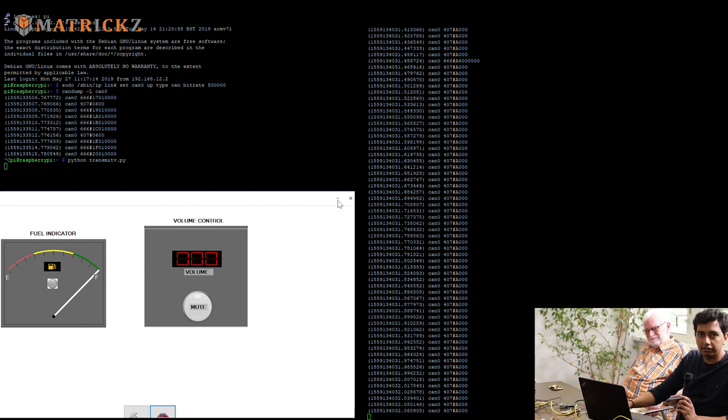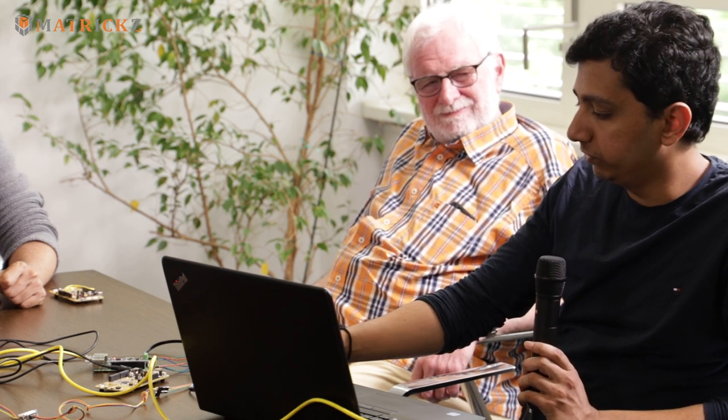This was just one instance where we have simulated an attack — to show that the CAN bus can be easily hacked into, easily hooked onto, and another node can easily send messages. It's all about identifying what each CAN message and signal does, and duplicating the same with our interceptor.